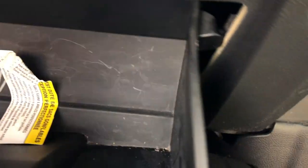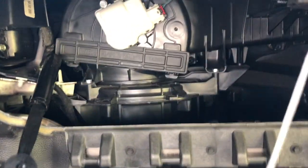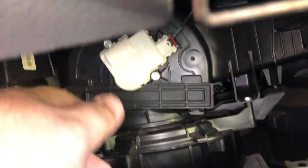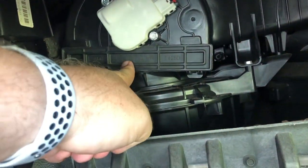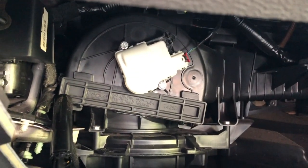Drop the glove box, in which case you grab each side and pull until these pop down, and then the glove box will just pop out. And that leaves your hole to your dampener and your filter. All right, so the first thing to get is just 2 bolts to get through, and a power connector, or the interface with the computer, whatever you want to call it.